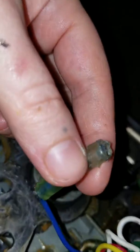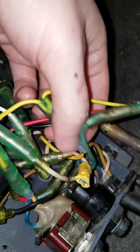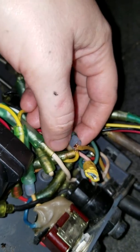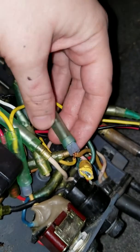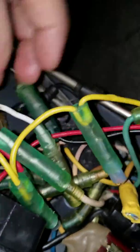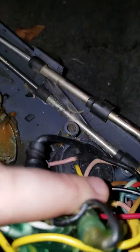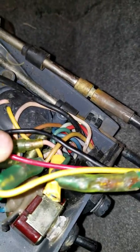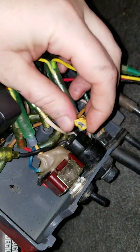I'm thinking that may have something to do with this over here, but I'm not sure. Also, this doesn't look factory to me — I don't think Yamaha would have left coiled-up wire. This blue thing going into this factory green connector doesn't look factory. It's coming from the main wiring harness, going into there, and then going into the buzzer.